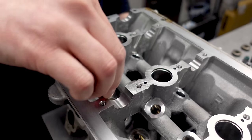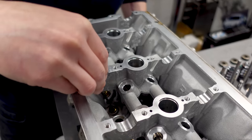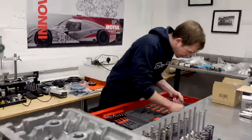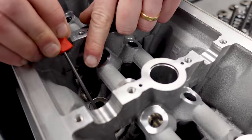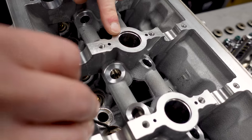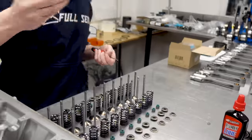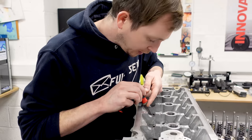The only thing you've got to watch for - this is why we have an airline as well. Heads are cleaned, they've been chemical cleaned, but sometimes what you get as you've pulled the stem seal out is the guide just pulls the lip of the seal off. So you just got to make sure you've got all those out. Double check that before we put the next ones on - that one's got a spring seat, that one hasn't.